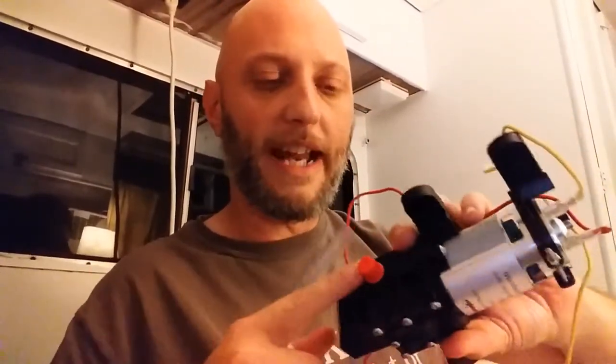While I was doing that, I was thinking — the new one is much smaller, and it has smaller entrances and exits. So I had to get some adapters. What I am going to do is take the adapters — this is the one for the fresh water that I had. I should have some tape of some sort; it may help. So that fitting goes in there, just like that. This is going to go into the old supply side from the fresh water tank to the pump.